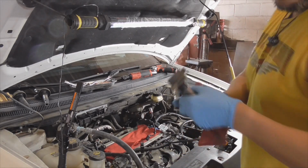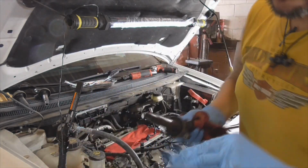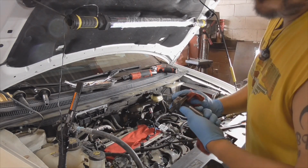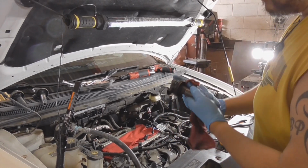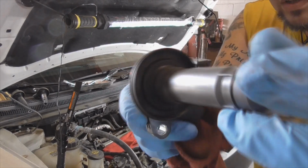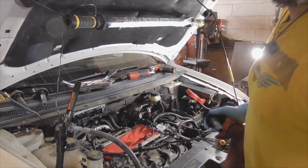Even though they're the boots, as you can see here, the boot seals the spark plug port. You still want to, you never know, just get any dust or any little pieces of dirt or anything you might have in there. Okay, I'm gonna go find some grease. Just put a real thin coating here on the bottom of the boot. Just enough so it'll seal properly.